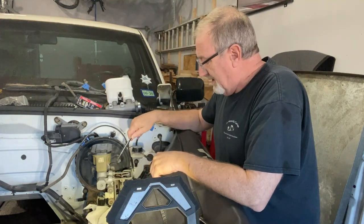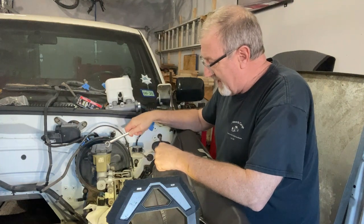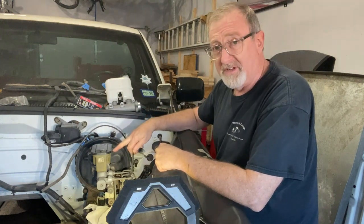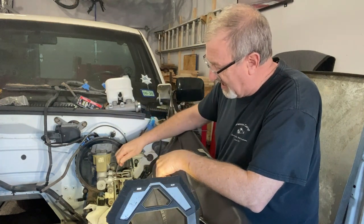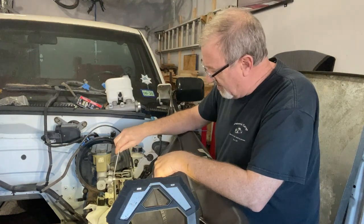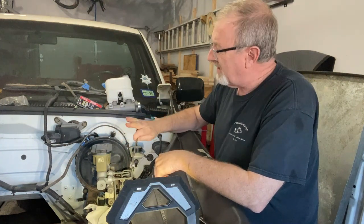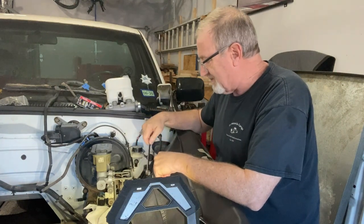You want to be sure — either remove the cap because those little tabs on there are deadly, or use a longer wrench, a pair of gloves, or something, because these lines have been on here forever. And when they let go, they'll let go, and you'll tear up a finger or a knuckle like I just did. So be careful.